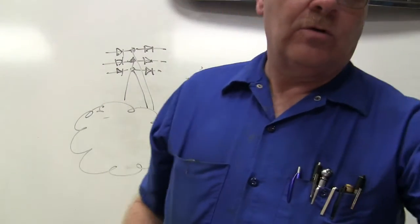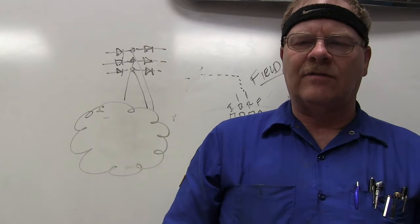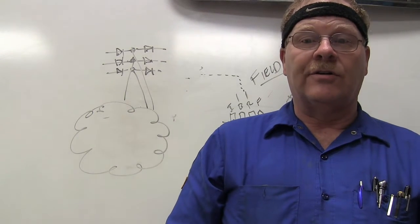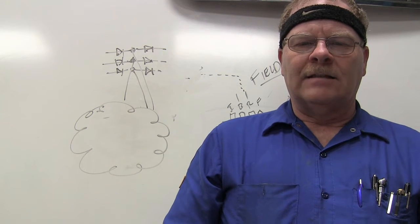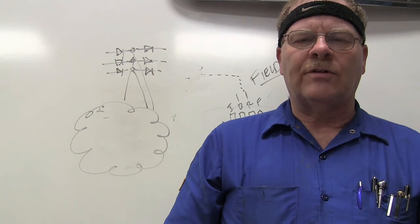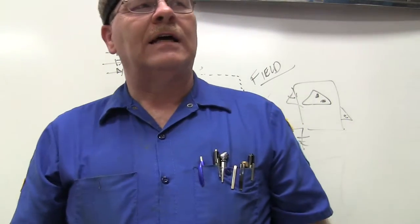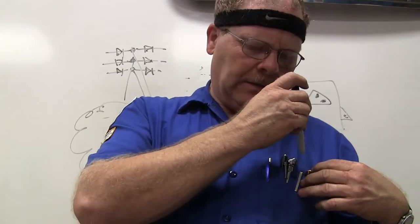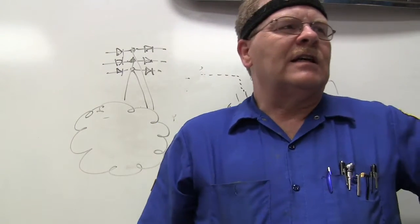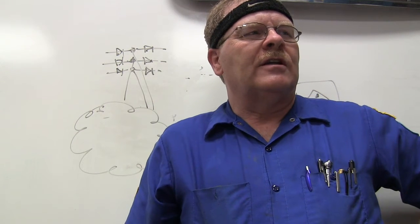And let's look at the primary difference between a generator from the 1950s and an alternator, which is also called a generator today, even in some manuals. What's the difference in the field on an alternator and on an old generator? You know the old generators that look like a starter? The difference is that they had brushes like a starter, and the field was in the middle.